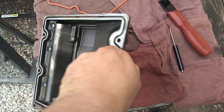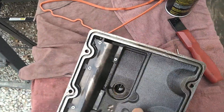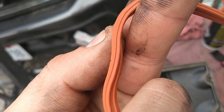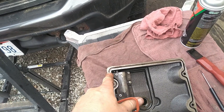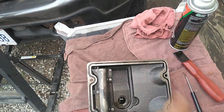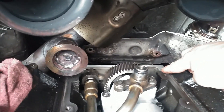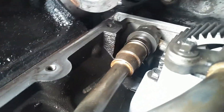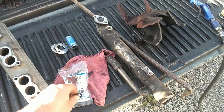I got the cover cleaned up - it doesn't have to be perfect, just try to get all the loose junk off there so it doesn't fall down in. I pulled the old gasket out - when you get the new gasket there's going to be a side that looks flat and the other side looks kind of pointed. The flat side goes into the groove, the pointed side is facing up. One more thing: where the back aluminum plate meets the block, you need to put a bead of silicone there - those will leak if you don't. Put a little bead of silicone there, then put the cover down in.